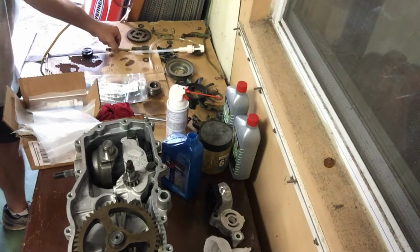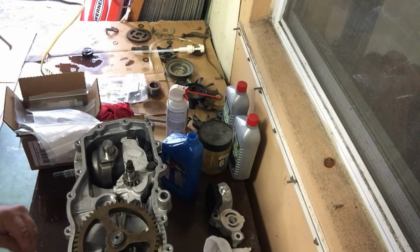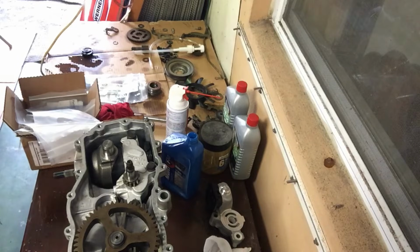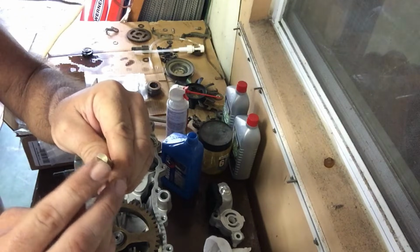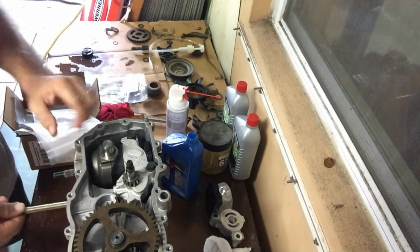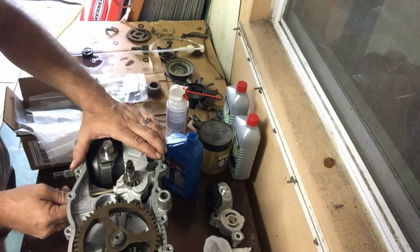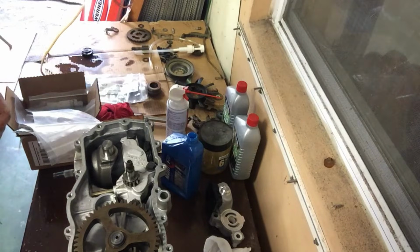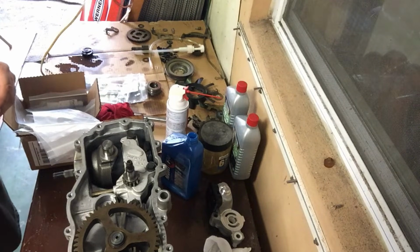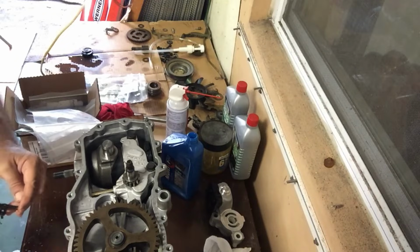And let's see, next thing is this bypass rod. Dirt on it. I believe this only goes in correctly one way, and that is with the half moon, the flat part right here, facing down. Sticks in there, and then it sticks through a hole in the center section, like so. Oh yay, then there's another retaining clip that needs to go on. This one doesn't look as challenging. Again, this is a retaining clip. It's probably in your seal kit.